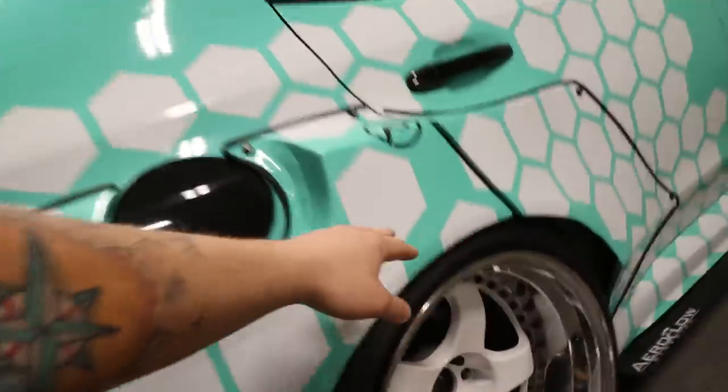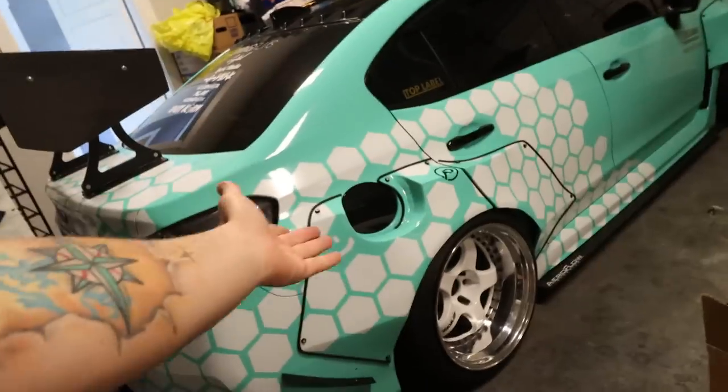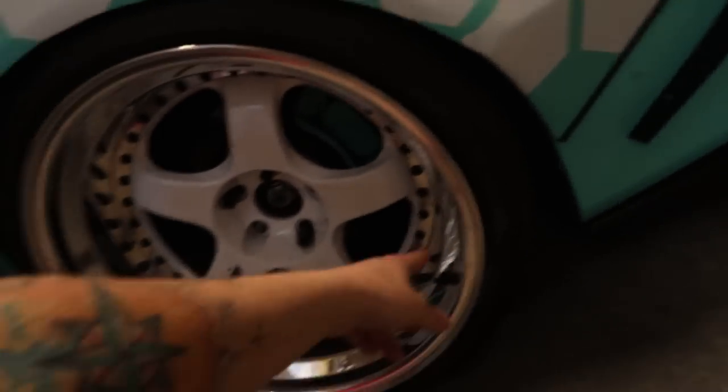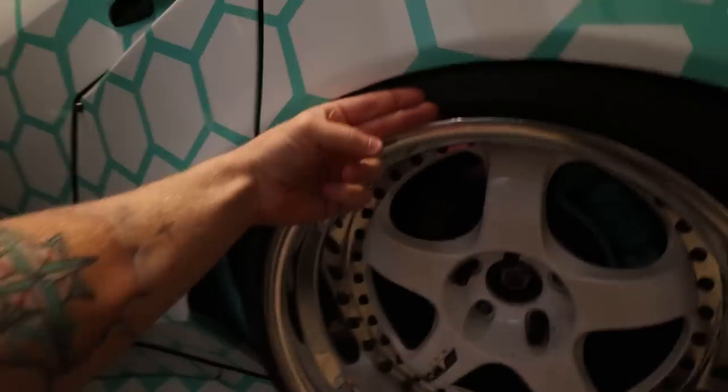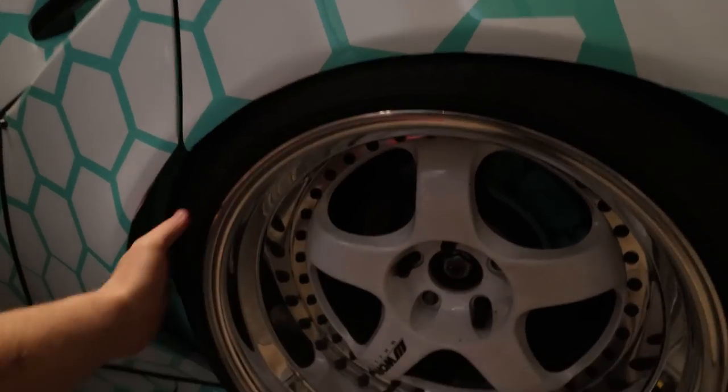I only have this at about 25 PSI. That could air out and go lower, but it's not going to do anything because it's sitting on the tire. So that is the problem. This tire, actually, turns out the valve stem is broken, so I do need to get the other valve stems installed. As you can see, like I said, about 2 fingers before we come down all the way. It's just sitting on the tire.